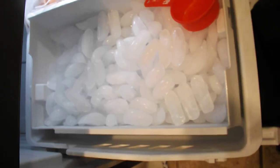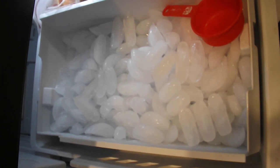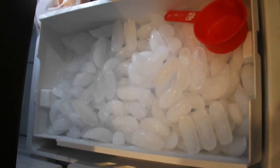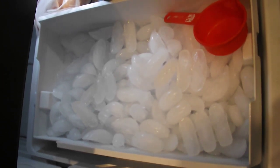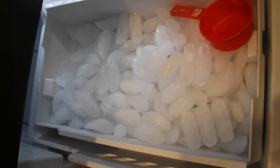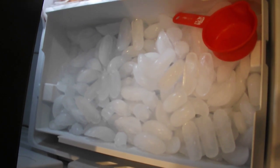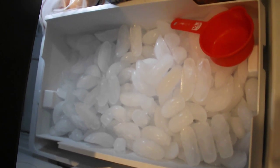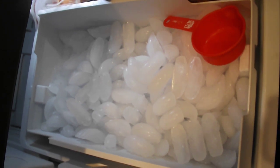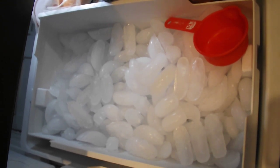We did put it off. The filter status button is not blinking now. You can reset that at least once, sometimes twice, but when you start losing your ice-making capability, putting in a new water filter will get you better ice and better-tasting water.